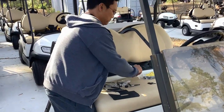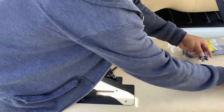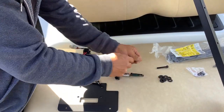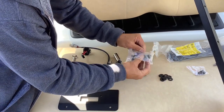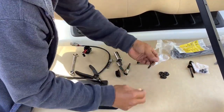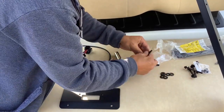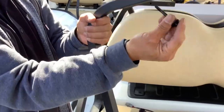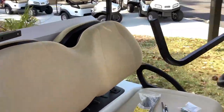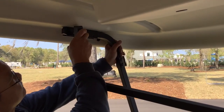Get your hardware — bolts, washers, and nuts — prepared. The bigger ones are for the mirror, the really small ones are for holding in the VDU, and the long bolts are the roof bolts. The shorter bolts are for the VDU bracket. We need a washer on the base side of each roof bolt. If you're only one person installing, start by putting one bolt from the inside going out on the driver's side. The crossbar actually goes on the inside of the existing strut, so you need longer bolts to make sure they pass through.